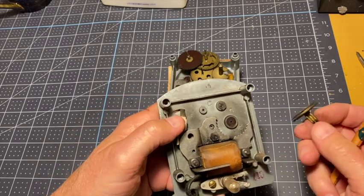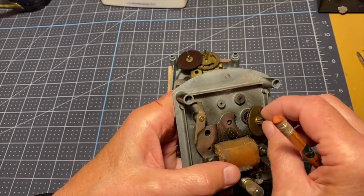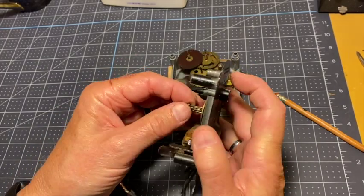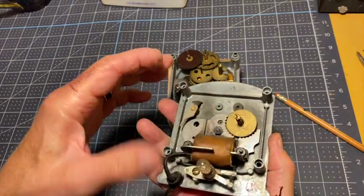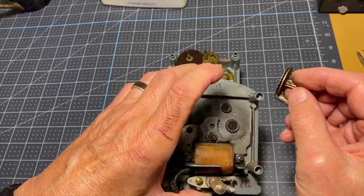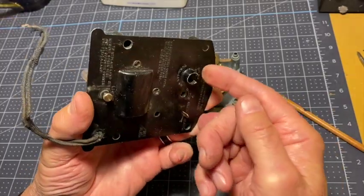This is the stator for the motor. The magnetic fields created on these two poles are transferred to these teeth, and it drags this motor whichever way you spin it. It turns out these clocks are spin-to-start — you can start them in the other direction so the clock will run backwards just as happily as forwards. This is an alternating magnetic field pulling on this pulley because there's steel here and brass here. Brass isn't affected by a magnetic field, but this steel plate is, and it gets dragged one way or the other depending on which way you spin the start button.